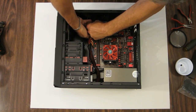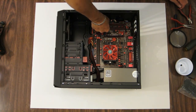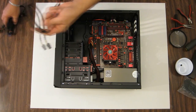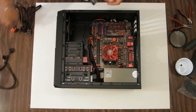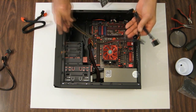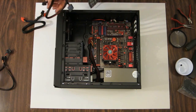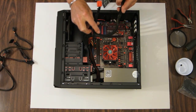All right, Father, you're going in there whether you like it or not. And she's hooked up. Now the cables I have for the modular, semi-modular power supply. I have one that goes directly to this front fan only. I have SATA connectors for three. It's going to power up the optical drive, the hard drive, and I left one in case they add another hard drive or SSD.